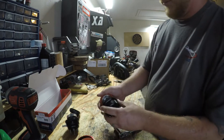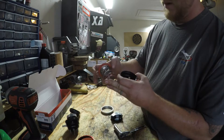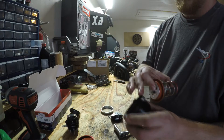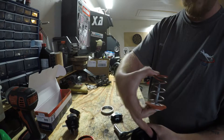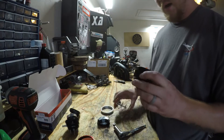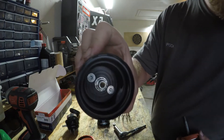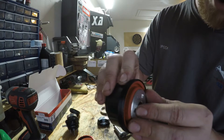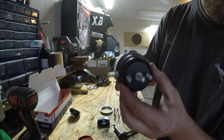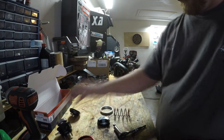You take the nut off and then the spring comes out — it's pretty much similar to the other wastegate as well. This is a 14 pound spring, same style, with the diaphragm up top with the lid. It looks like a dual sealing diaphragm compared to the other one because once compressed inside the ring you can have vacuum pressure on this side and on the cap side. As you can see it's got a cleaner seal — a little bit of boost could sneak by probably, but it's a pretty snug fit compared to the other one that just has the little rubber gasket and recess.